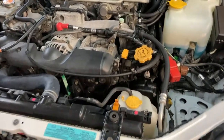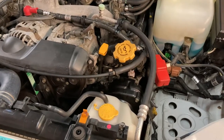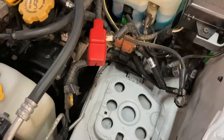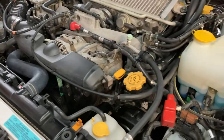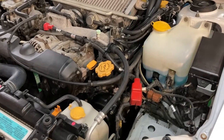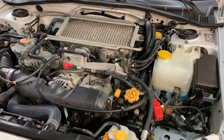They're not the easiest valve cover gaskets to replace, but it is doable. I haven't replaced them on this car yet, and this car has about 140,000 miles. The first step is to remove the battery — I kind of did that before I started — just to give you an idea of the condition they're in right now. Both sides are identical and they're both leaking pretty bad, so I went ahead and ordered all new OEM valve cover gaskets and seals.